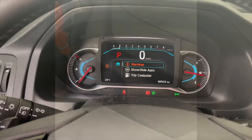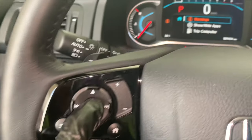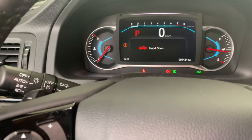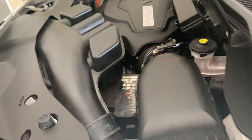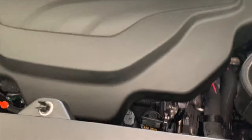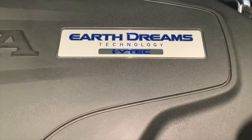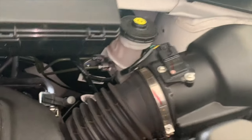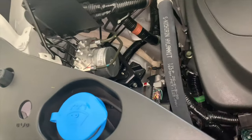After I put in the correct amount of oil, it's really good practice to start the engine and keep it running for maybe 2 or 3 minutes, and then check the oil level on the dipstick in case you need a little more. But it should be okay if you put in 5.39 liters or 5.7 quarts, as recommended by Honda on their website, and if you changed the oil filter. So the car is starting now and I'll check it again.